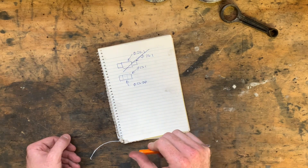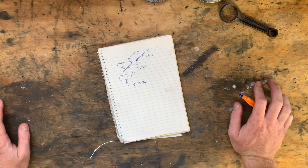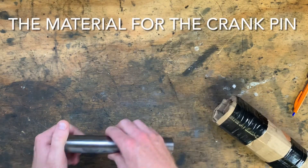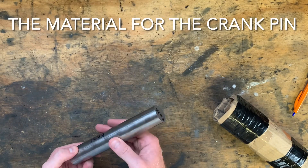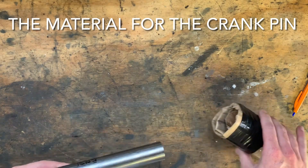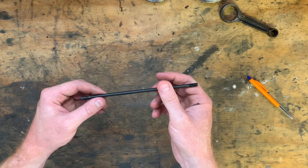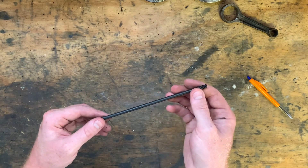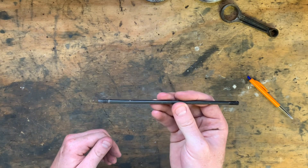If the big ends for the CRF are in fact 23.00 millimeters, as for my steel — I ordered EN36A but it got lost on the truck, unfortunately, so it was delayed about a week. It's 33mm in diameter. On another note, I need to get myself some 6 millimeter solid 4140 round bar, although I haven't been able to find any — my supplier doesn't sell it that small. I'll shop around; I was going to make a new set of eight studs for the engine.